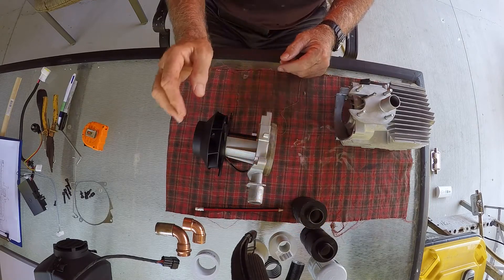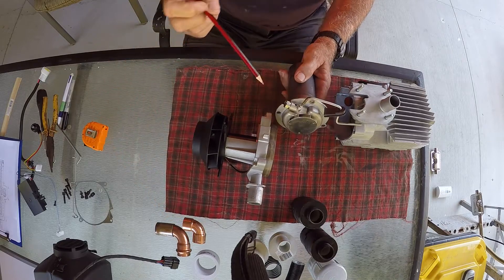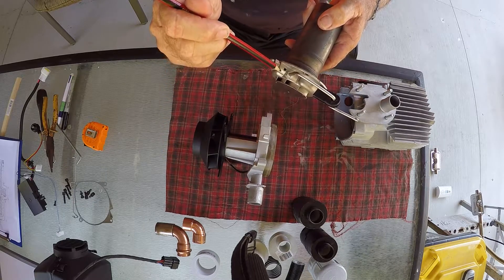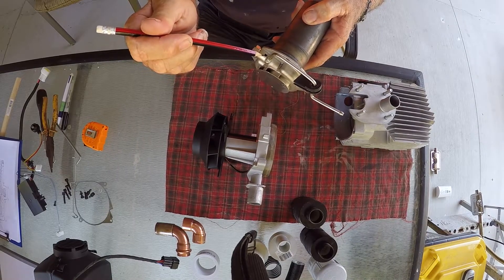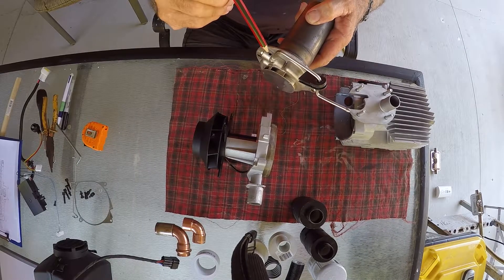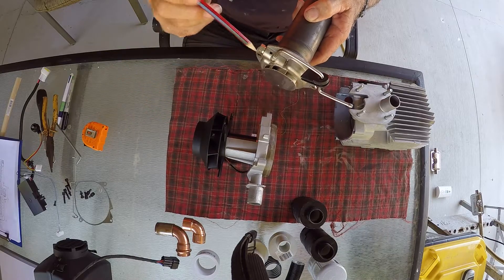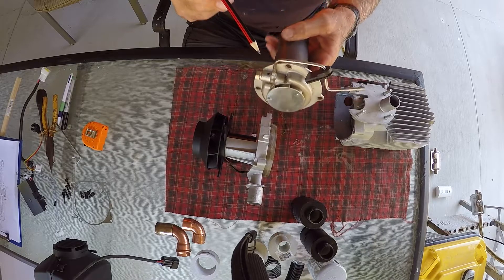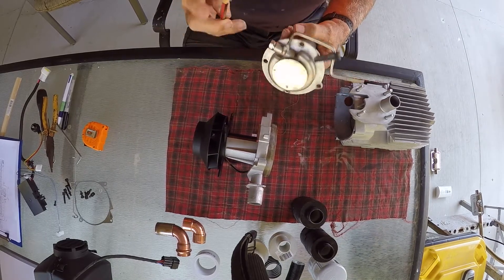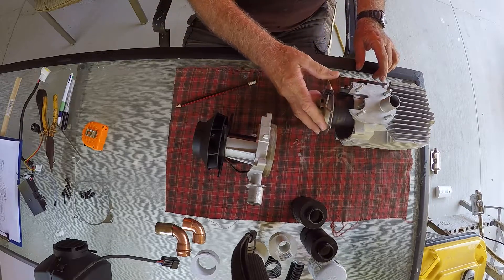The reason you need a filter is that when air comes in and you first start combustion, it comes through here - this is the fuel inlet - and every single bit of air to start combustion has to go through this little hole, about 4 millimeters diameter, about three-sixteenths of an inch. If you suck in a fly, a bee, a beetle, or anything - a bit of wing - gets stuck in there, this heater will not light. The air must go through here past the glow plug to start combustion.